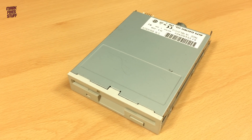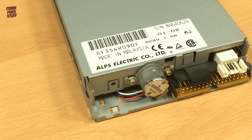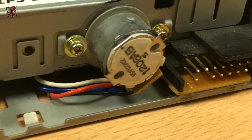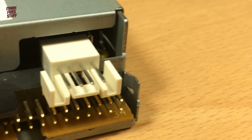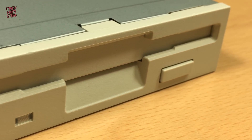This is a very common PC compatible floppy disk drive. It won't work in a Commodore Amiga - trust me, I've tried. Even though the connector looks the same and indeed fits, some of the pins deliver different signals. But all that is about to change.